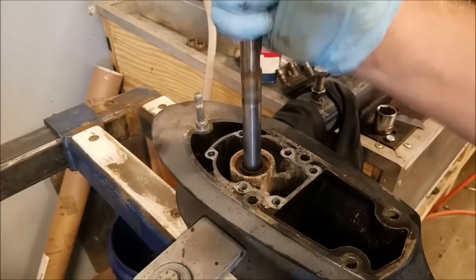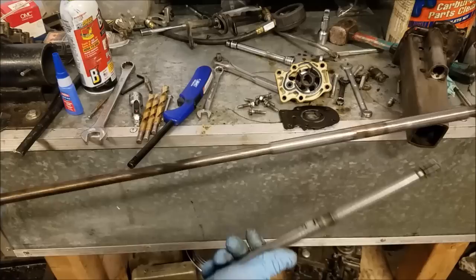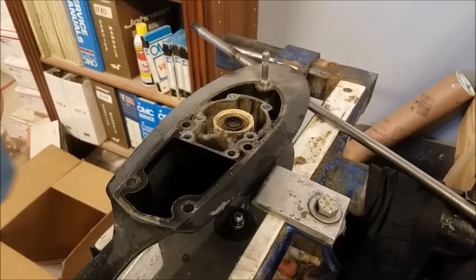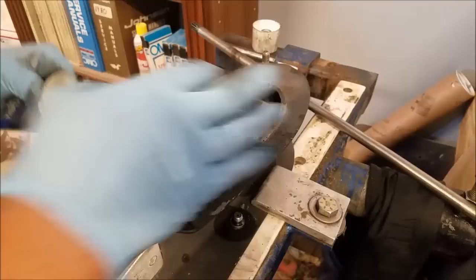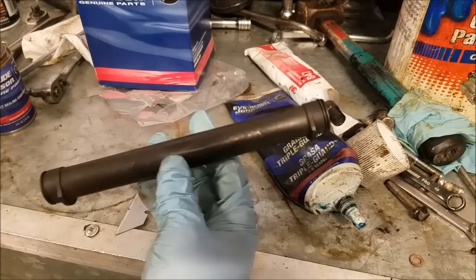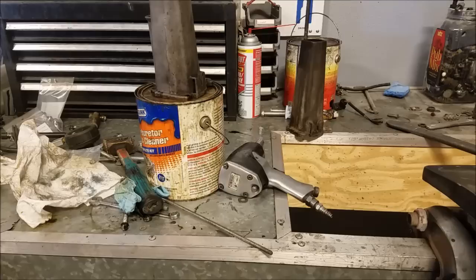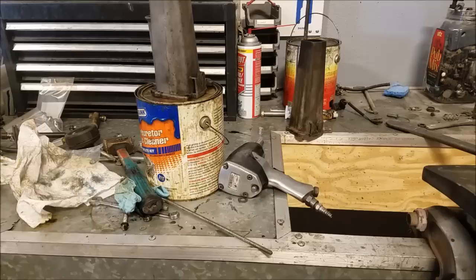Alright, with the water pump out our drive shaft will slide right out of there. And here is the comparison — the new short shaft versus the original long shaft. Now whenever you install new seals you're also supposed to put some triple guard grease between the lips, so I figured I might as well do that too. With the drive shaft out we can identify its part number: 328317. That part number was used on engines up until 1995; in 1996 the shaft was the same but the part number changed, meaning our engine is a 1995 at best.